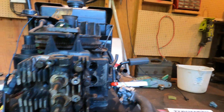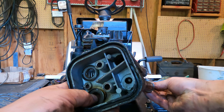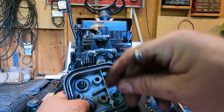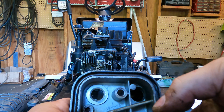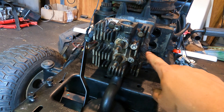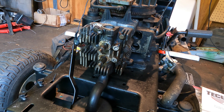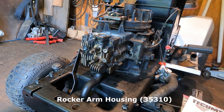We're going to have to get all those tightened down before we do the valve cover housing. Then we can put this on. One of the push rods — the one on the bottom — has to go in first. The other one you can put in later. This one can't come out without taking the whole valve cover assembly off, so you install it that way. Head gasket installed, head tightened down. Looking online, the specs say 16 and a half foot-pounds — 200 inch-pounds — for the head bolt torque. Let's get the valve cover housing on now.